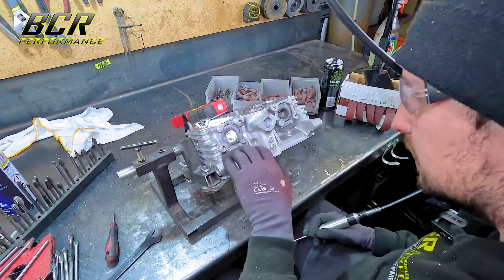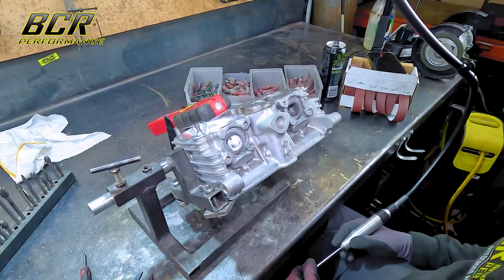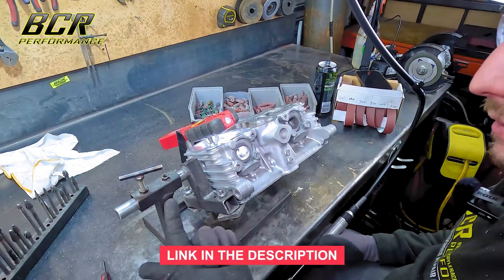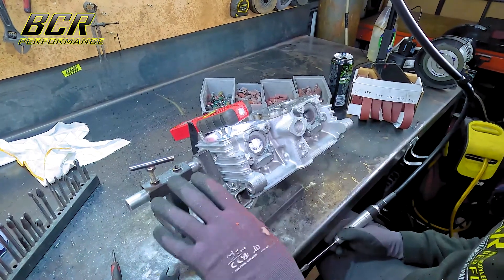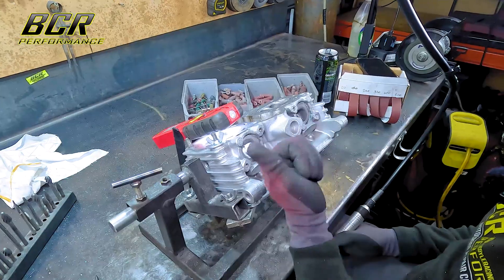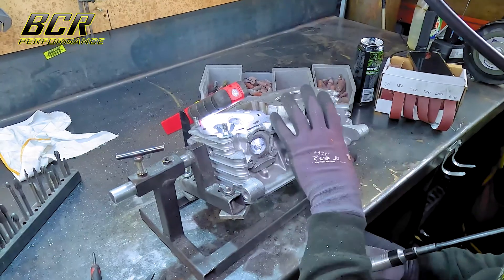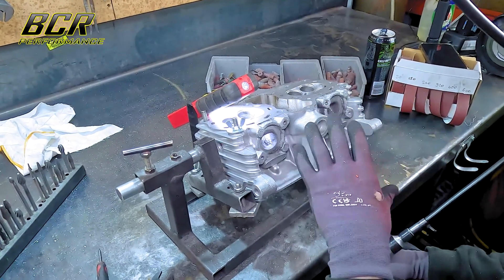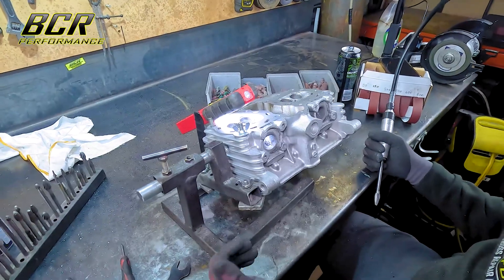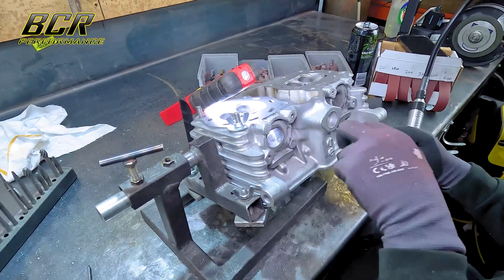We've finished the port from the other side, now on to the back side to finish off shaping the guides and then move on to the aluminium. Effectively what I'm doing now is the same as the bolt-on kit available on the website - that's a fully gas-flowed head with high-lift cams and a lightweight flywheel. The head I'm doing here is exactly what you'd get with the bolt-on package. The good thing is if you don't want a full engine rebuild, you can either send the head to me or I can provide a ready head with everything done - all seats cut, new stem seals, new cams fitted, fully shimmed. All you have to do is take your old head off and fit the new one for an instant power increase. You may need a dyno run to adjust fuelling, but that's it.